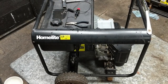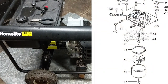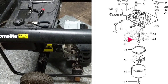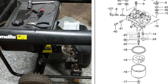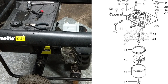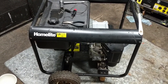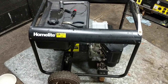To find parts for this machine I typed "EY28 parts" into Google, and in the diagram the main jet assembly is broken up into three different pieces: the main jet at the bottom, the distribution tube, and the threaded insert that goes into the main intake tube of the carburetor. Without removing and disassembling those three pieces you can never ensure you've got them perfectly clean. I'm hoping that breaking stuff up in the ultrasonic cleaner first will loosen enough gunk so that I can remove that main jet.